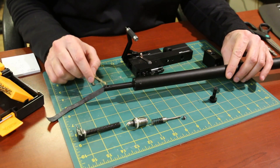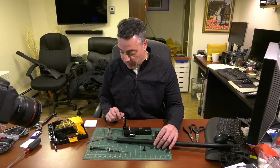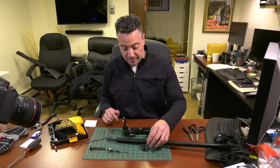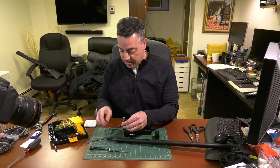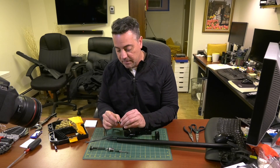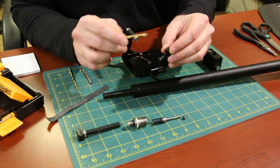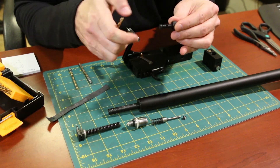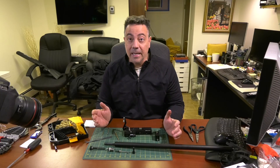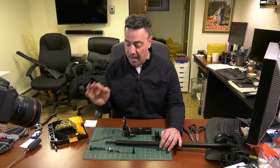That's a tight fit, so that's definitely the first bottleneck. This can easily be opened up to 3/16ths — we can go another 32nd of an inch. The same thing for the transfer port on the power adjuster wheel. What doesn't fit is the 11/64s, so we're gonna open this up to 3/16ths as well. Opening up the barrel port is going to give the largest efficiency gain because that's the smallest — that's the bottleneck.